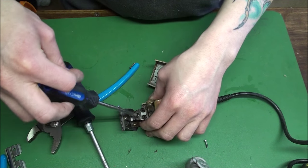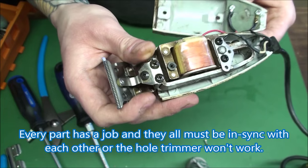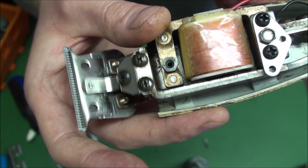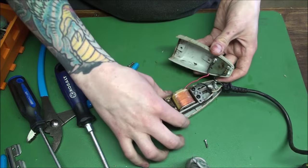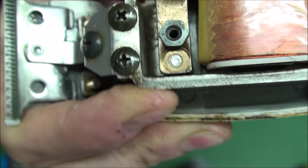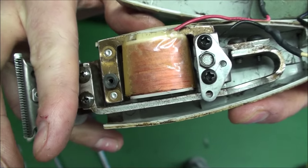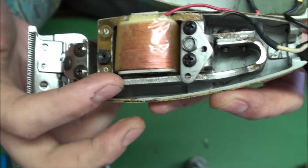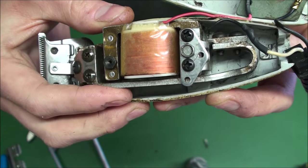You gotta find out the way. When you want this to be in there but not rattling around — so that's perfect. You can look at the arm and set your arm like that, and hopefully it's right. Here's how far it is. And when it's too close, it starts rattling. This arm bends over time because it's on a spring and it's constantly pushing out, then the alternating current pulls it back in, so it's rattling all the time. So if this arm is a little more bent than mine, you're gonna have to adjust this even farther. If it's not, then you will need it closer. And if you can't get the designated power even when it's close, it's probably because this arm is too tight onto this cutter blade.